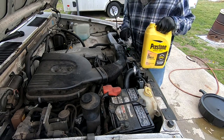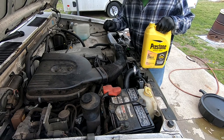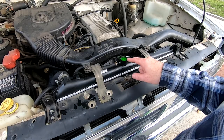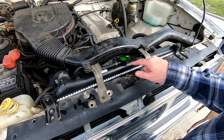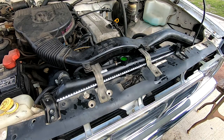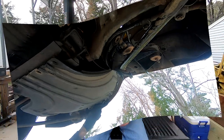All right, we started her up — it's going to take a few minutes to get warm. I turned the heat on full blast to circulate the coolant. We're waiting for the coolant level to drop down so we know the thermostat's open and we can add the rest of the coolant. The last step is to put this shield back up. That's the whole deal — you just saw me change the radiator in the Nissan. It was no problem at all and it's definitely a DIY type of project.